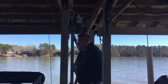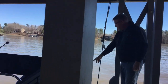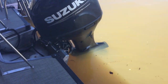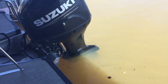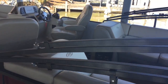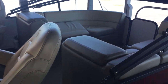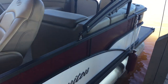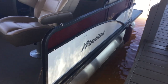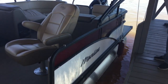It's imperative that you don't start the engine until the propeller is completely submerged in the water. You can't start the engine with the engine out of the water — it needs the water for cooling. Right now the propeller is in the water and the boat's rocking, so we're going to continue to lower it. Once the boat really starts rocking, you know it's being supported by the water instead of the lift, and that's when it's okay to stop the lift.